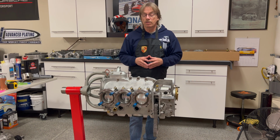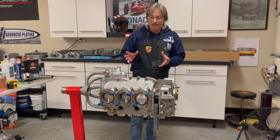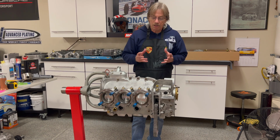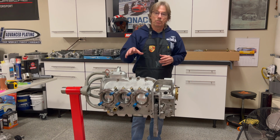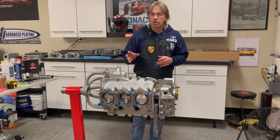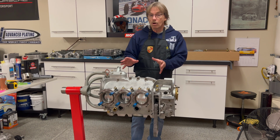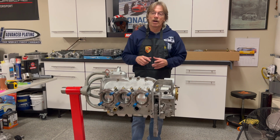valve clearance issue. The reason we're going to check this out is because we just installed our pistons. Different profile piston, the whole geometry of the thing is completely different than our original ones. And then the cams we're putting in here, I had new profile ground to a period correct cam spec for this engine. So I don't know if that cam is going to work with these pistons. We've got to find that out.